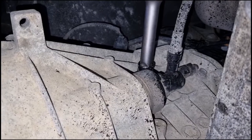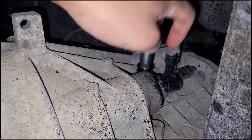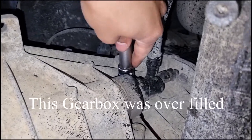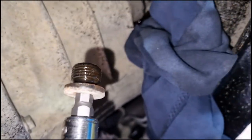Make sure when you're opening this and pulling down on your ratchet, don't damage your slave cylinder — it's plastic and you will crack it if you're not careful. This is the fill plug removed; now we'll go ahead and drain the fluid from the back.